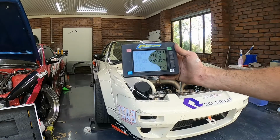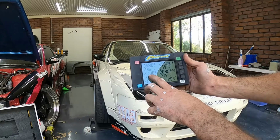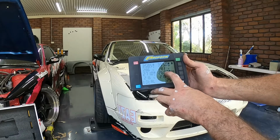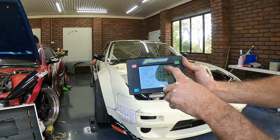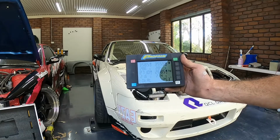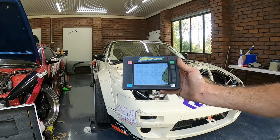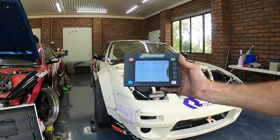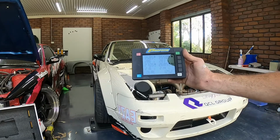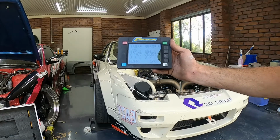Righto guys, so I've done one complete turn on the left hand rear down here, so that's 271 now, and we're at 269 on the opposite, but we probably could come up a little bit on the front right, just give it a little bit of pressure. But I'm not too worried about that because that will counteract with me in the car, so that should be okay. That's not terrible. We're at 1253 kilos, so that's not too bad.